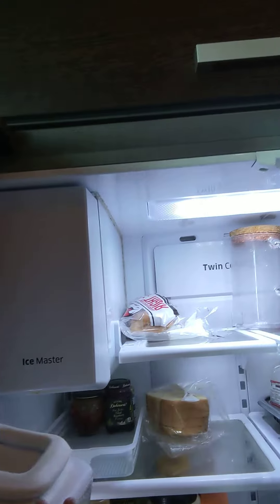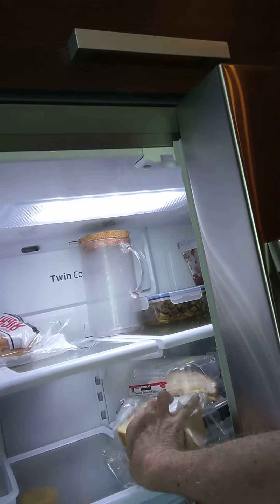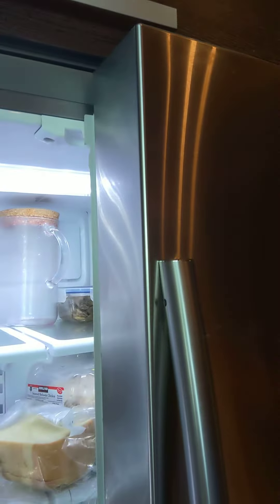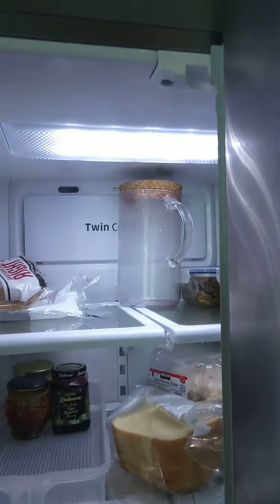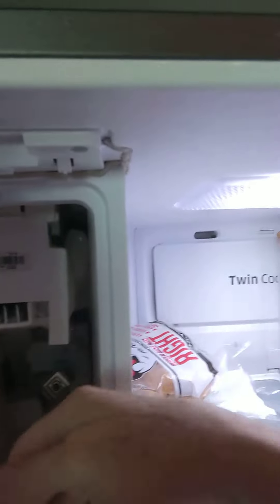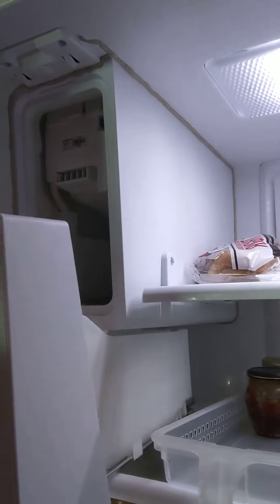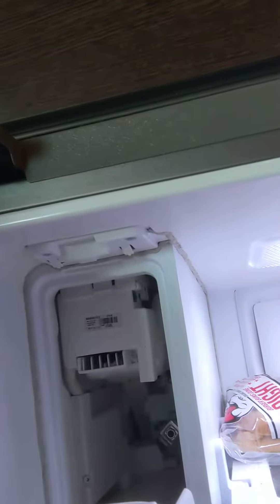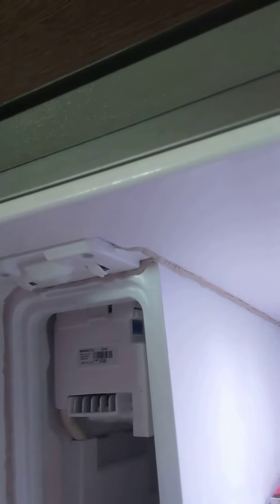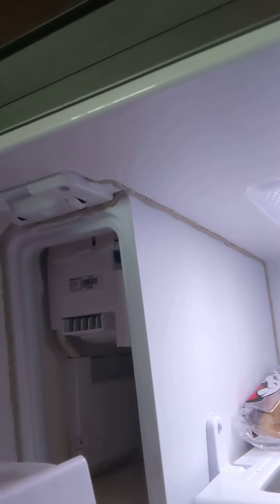Right now I noticed it didn't have a lot of ice, so I opened it up and found that, as I imagined, the ice was stuck on the side. I already have this set up with it underneath. I had also tried to put putty on the side to see if that would stop the humidity from getting in — that's the problem: the humidity gets in, it freezes, and the ice cubes get stuck.